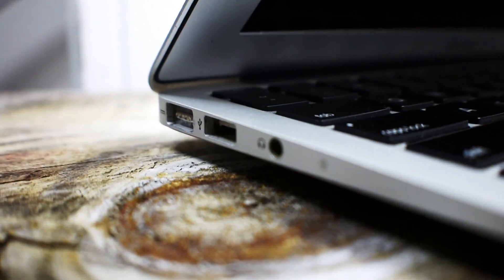After you're done with this fix, I do not recommend putting all the screws back on because it's a pain to take them all back out every time. Just the corners should be fine to keep it stable. If the MacBook ever reaches 0%, you're going to have to do this again. Keep that in mind. You'll probably want to keep it tethered to a charger every now and again, but from this point on, you're going to need easy access to the internals.